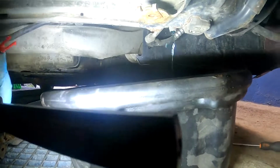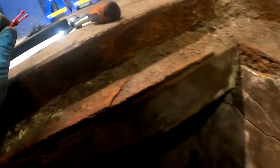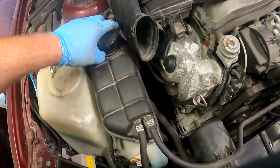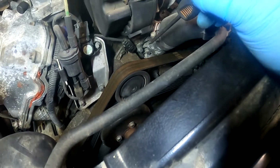And let's start the procedure. So just turn it. Not too much. Let's see. That's it. Okay. So I pull it all out. To make it flow better, obviously, let's go to the top and open the coolant reservoir. Crack this open. You hear? Oh, now it's splashing. As the coolant is running empty, let's start opening hoses from up here.